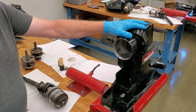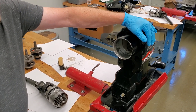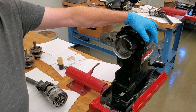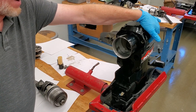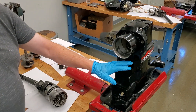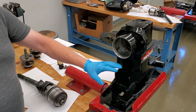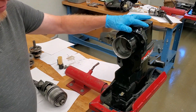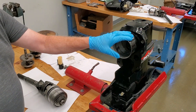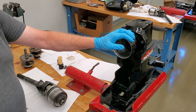This is an earlier Alpha 1 Gen 2, and you can tell by the sticker on the side — it has some red graphics on the top, says Mercruiser, and then gray underneath. The later model ones actually have an all-gray appearance to the sticker, but you can also tell the difference by the way the upper gear case is put together.